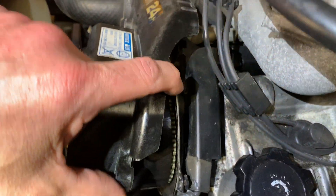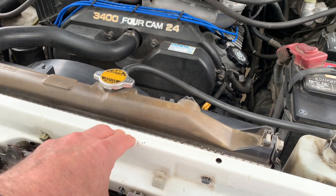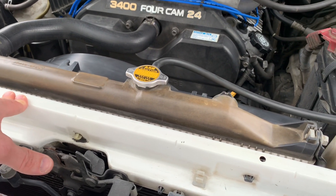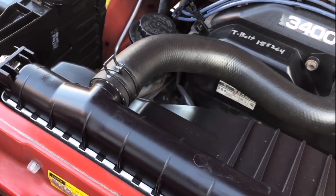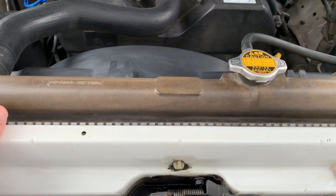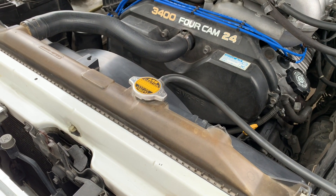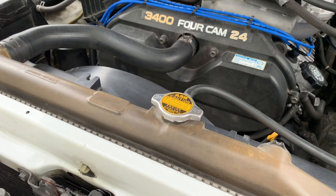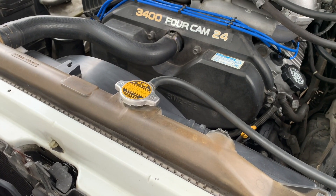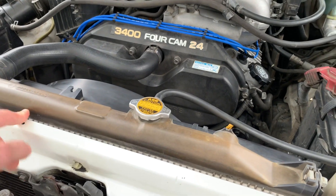I don't like the looks of it. Also want to look at your radiator, because those are a problem spot in these 4Runners and Tacomas. If it's an olive color like this, most likely it is an original radiator. If it's black and the plastic seems new, most likely it has been replaced. With 204,000 miles on this, I'm probably going to do that as part of the maintenance — rather than risk that pink milkshake, which happens on occasion, where your radiator fluid and transmission fluid end up mixing and ruining the transmission. Definitely worth $200 to get a new one and swap it.